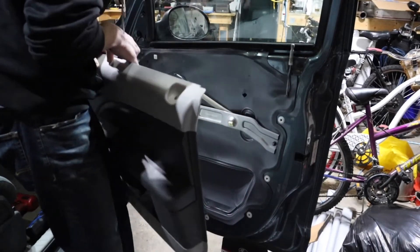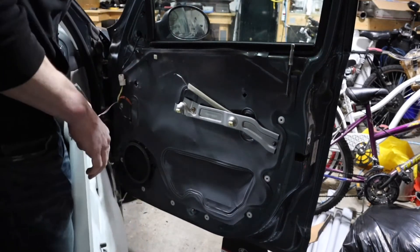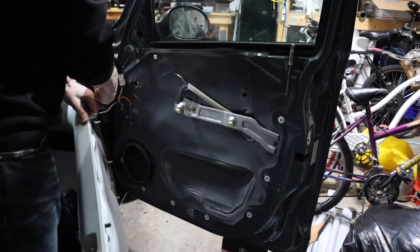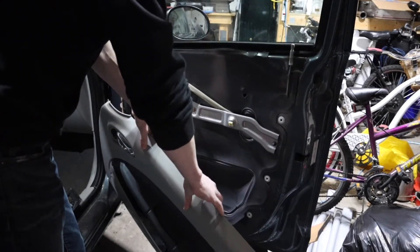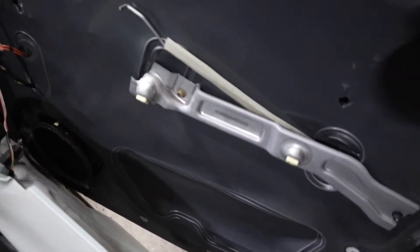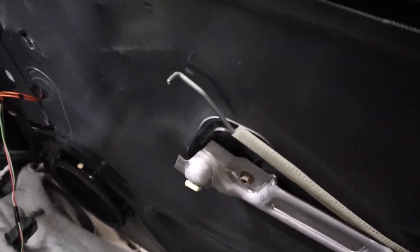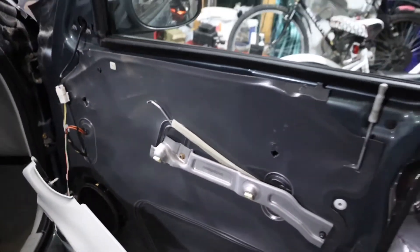I found the problem. Look at this folks. Watch out — there is a little bit of a wiring harness thing here for the power lock. That is the rod that goes to the lock. And that ended up being real simple. It hooks into — you can see here — there is a little kind of a plastic-y thing. That should just flip and clip. There's nothing wrong with it. Why did it fall off? Is that Chrysler just made something that falls off for fun?